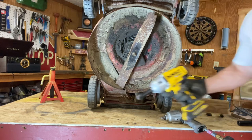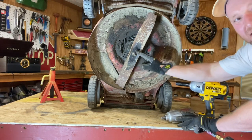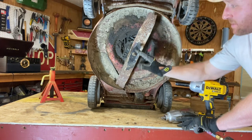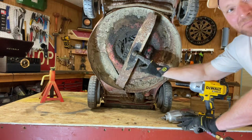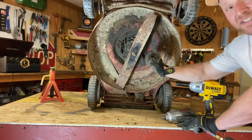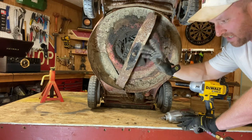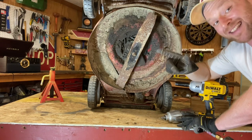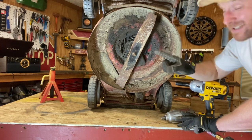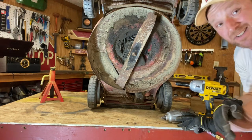All right, kids, now let's have some fun with lawnmower bolts. The one it's held on with is a 9/16 bolt that goes straight to the crankshaft. That's what spins. A lot of times, these things can get very tight, mainly because somebody uses an impact wrench to put them on, which over tightens them and makes it very, very difficult for the next guy without an impact wrench. So, to prove my theories and show you my test, I'm gonna use multiple impact wrenches to get this on as tight as possible, and then show you how to wrench it off just with your hands. You ready?